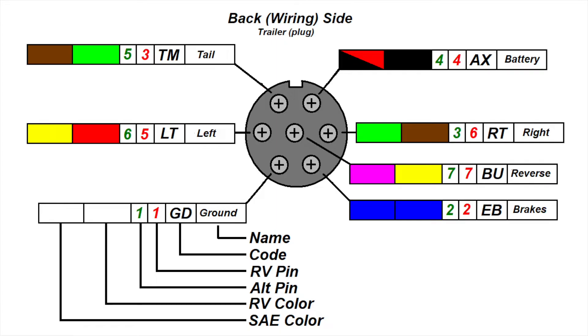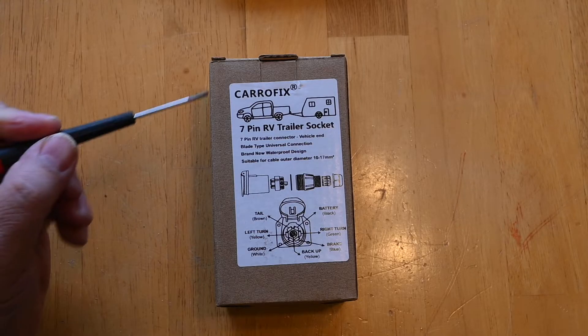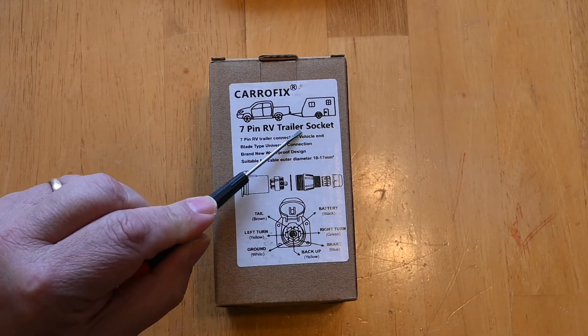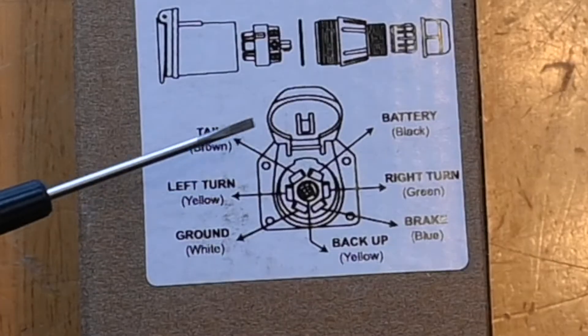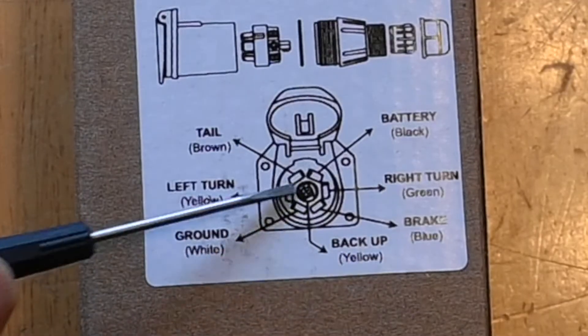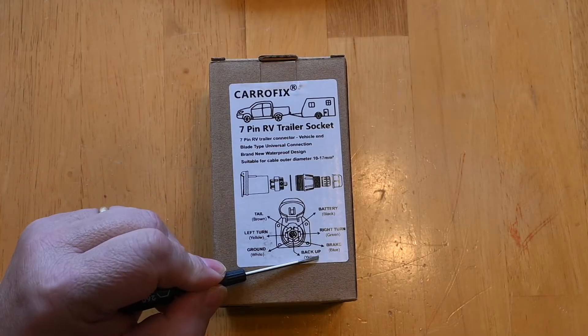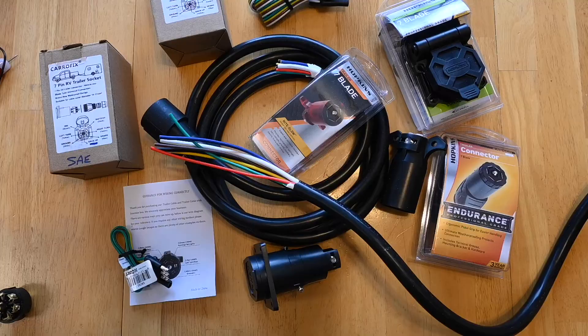The trick is to ensure that you get the correct connector. But there is another problem — most connectors do not state which standard they are implementing, so it's a lot of guesswork. And then we have eBay and Amazon offerings which really go crazy. This one says it's a 7-pin RV trailer socket, but if you look at the color code, it's the SAE color code, except they made a mistake — left turn is yellow and backup is also yellow, so they have yellow marked in two different places. It's hard to imagine how something as simple as a trailer wiring harness could be messed up so easily by the RV and trailer industry.